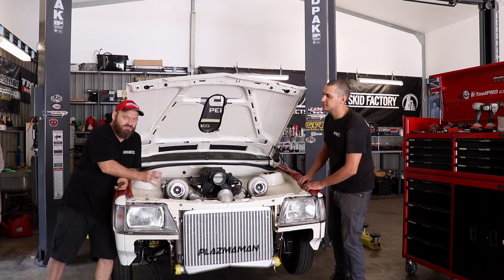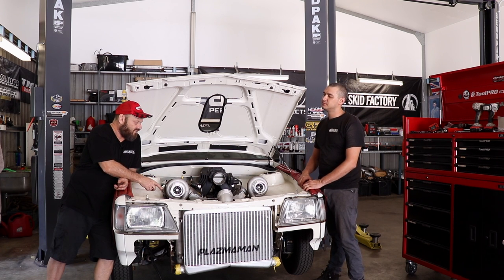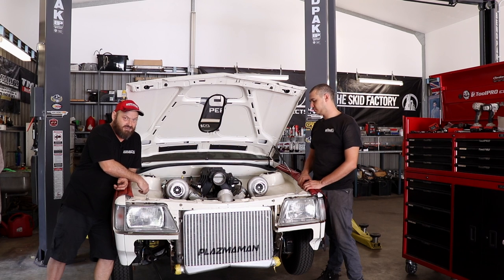I think this is going to do the job very nicely. It's actually pretty big and it's also quite efficient, which we found with Matt's car. It's not all about the size with radiators. It's got to have an efficient heat exchange going on, which a lot of old and/or cheap radiators just don't have. You can flow water through them all you like — if it doesn't actually exchange the heat out into the air, it doesn't cool the engine down.